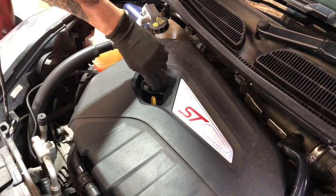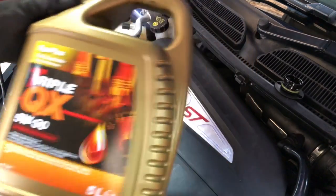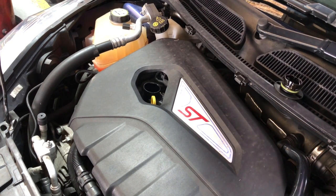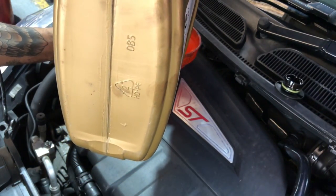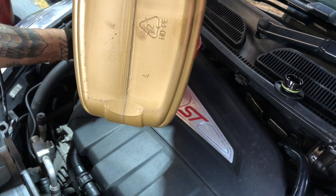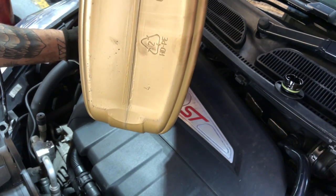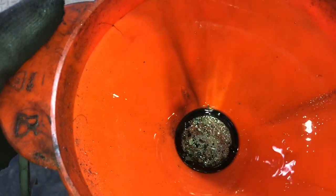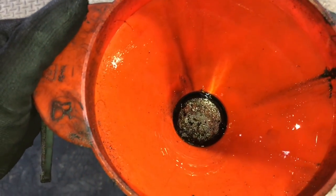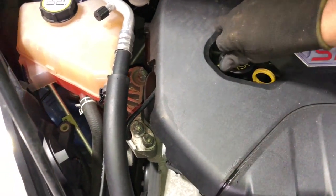Moving on - take out the oil cap and get out the 5W30 Triple QX fully synthetic oil, which was recommended by people at work. Get yourself a filtered funnel as well, and I'll show you why in a moment. We're pouring in the oil now - the amount you need for the Fiesta ST is 4.1 litres. If you need a little more go ahead, but 4.1 to 4.2 litres was enough for my car. As you can see, this is exactly why you need a filtered funnel - look at all the debris caught at the bottom; you really don't want that going into your engine. Once that's done, put your oil cap back on, jump in the car, start it up and leave it for about five to ten minutes.